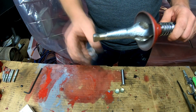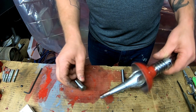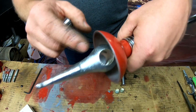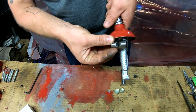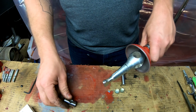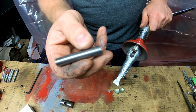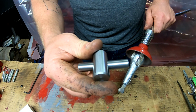you cannot assemble. Well, I should take that back. This actually needs to come back apart to put the cross pin in that goes through the actual shift lever. So basically this cross pin goes into this large hole and sits like this with the hole crossways like this. Okay? So when you get that cross pin in, what you have to do is push the lever. You see it's spring loaded. Push the lever down into the transmission top, and then you slide your retainer pin into place. And that goes through the larger pin that goes in the shift lever.